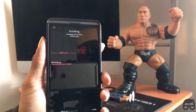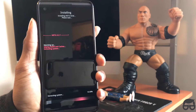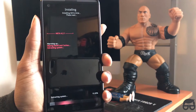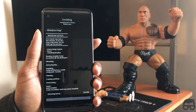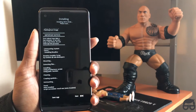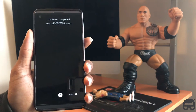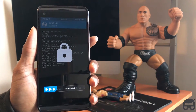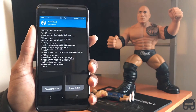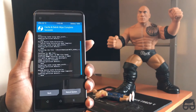I think that's about it — just click Install. I'll be back once the installation is complete; it's going to take a while. 70... 80... 100. Once that's done, just click Next, then click Finish. Swipe to unlock, and as another best practice, wipe the Dalvik cache one more time, then reboot the system.